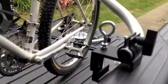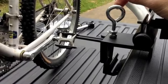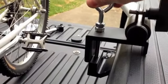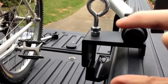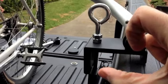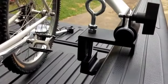So the whole point of this clip is to warn you that if you do drill a hole in your factory plastic bed liner in anticipation that this thing is going to work, it's probably not. So I would shy away from drilling the hole. One idea I had was to purchase a longer eye bolt, so I went down to the hardware and purchased this one — he's about an inch, maybe an inch and a half longer than the one that came with the unit. Still, this is the best clamping I can possibly get. There's not much surface contact, and the two parts of the clamp are pushing against one another against the rails of the truck, not over one another. So it's not a good contact. If I wiggle the bike, you can see there's a lot of wiggle room there.